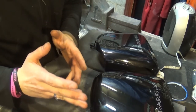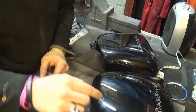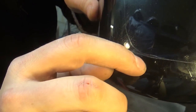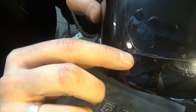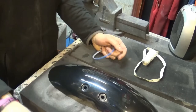And when the paint is dry in 24, 48 hours, I usually advise 48 hours for the customer, window cleaner and everything comes off. If there's any kind of marks, like this part over here, see the lines going a little bit out, I'm not going to paint this way. I'm going to follow directly, slightly on top of that, and that's going to be sticking out. Window cleaner will take care of it. So, happy days. Let's move on.